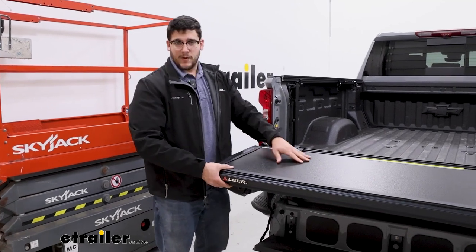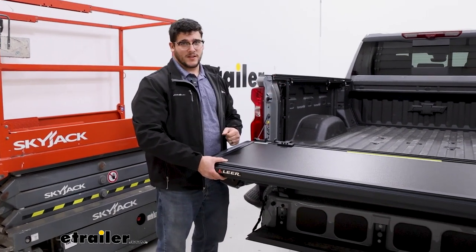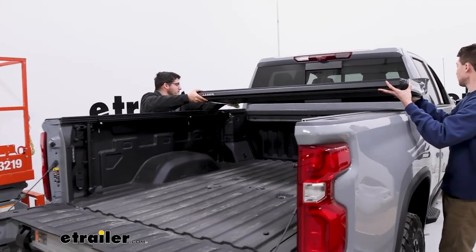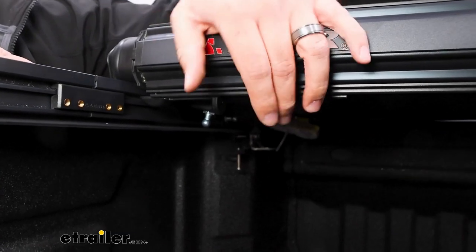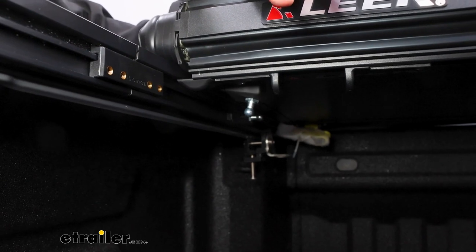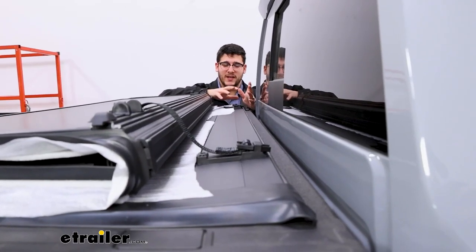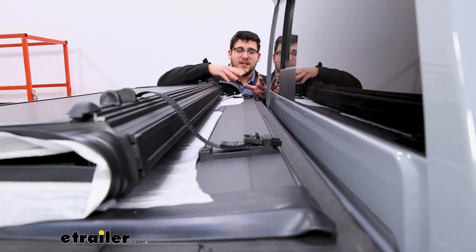We can finally move over to the tonneau cover itself and lift it on top of our bed and rails. I recommend grabbing a friend — we've got Ethan here with us today and it's going to make it a lot easier. Just lift up and over our bed. With it everything feels pretty stable, just move that over and roughly place it on the back. You'll notice by my hand there are these two levers, and when putting this into place, set it down and push it around just a bit to make sure everything feels right — you should feel a click, and that's where this handle seats into the side of our rails. Another thing I recommend checking is this flap near our bulkhead — we're looking to make sure it's the same distance on both sides to make sure everything's even.